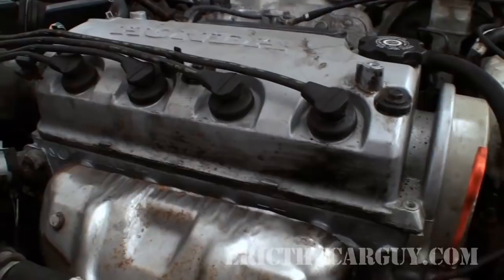Don't worry, my door is open — I'm not going to asphyxiate myself. This is a pretty large space, even though it's enclosed. Now I'm going to look around, check for any leaks, check for any check engine lights, anything that might crop up as a result of the engine swap — in particular leaks. And I actually think I already found one at the water pump, which is really unfortunate, because I had to replace the timing belt and everything on this. I think because this engine got so hot, it cooked the water pump. Last time I did this engine job, the water pump was new.